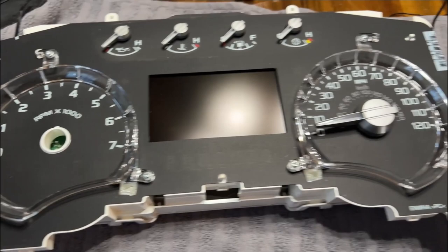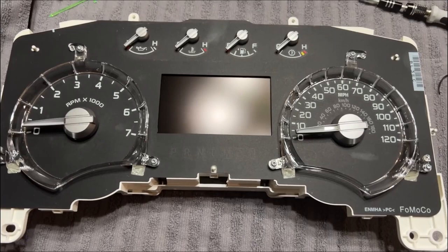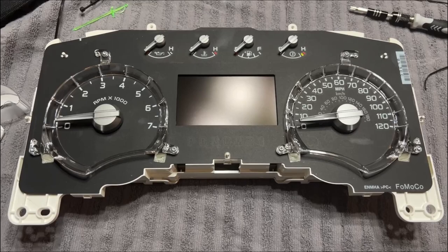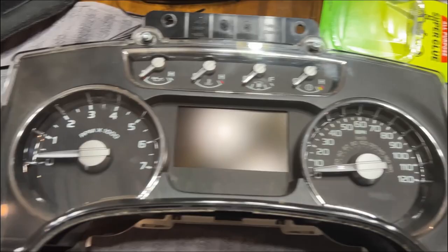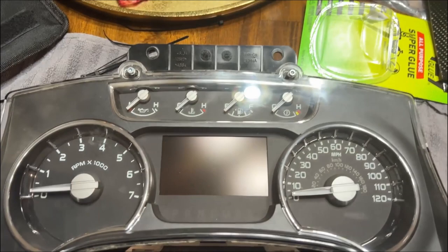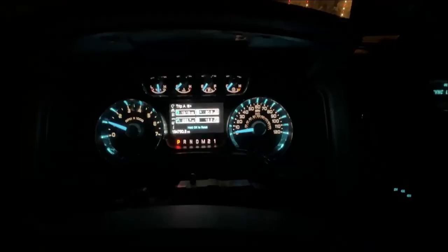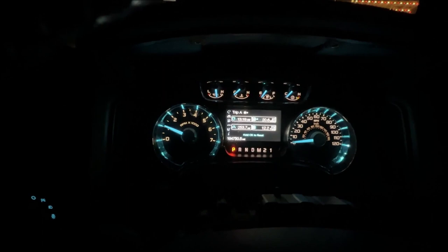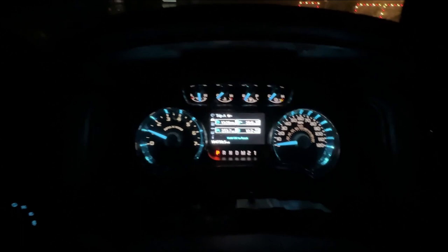Alright, got it all glued and pushed back in. I brought it out to the truck, plugged the harness back in, started it up, revved it up and the needle went up, then turned off the vehicle and it dropped down — pretty happy about it. Just need to put the faceplate back on and install everything back. She's a little dirty but it clipped on real easily. It's dark now but we got it plugged in — the tachometer is staying around one at idle speed, and giving it a little rev you can see it's working. A pretty easy install. Before, when the needle was off, the LEDs behind it were kind of blinding when driving, so happy to have it done finally. Thanks for watching!